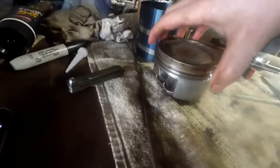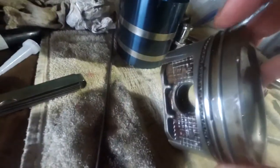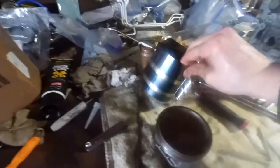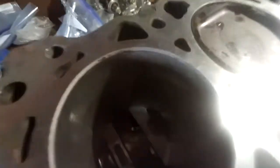So we got the pistons all cleaned up and ready with rings positioned. The way you do it: the arrow on the piston points towards the front of the motor. The top compression ring gap points to the back. The next ring down is 180 degrees off towards the front. For the oil rings, there's a little notch for the top one so it can't move, and the other one goes up at the top corner — so they're both in the corners. Now we're going to put this over the piston and drop it into the bore — number four is already in.